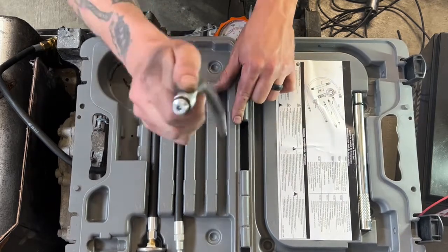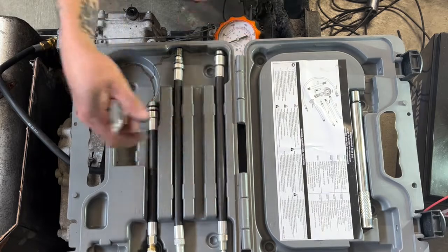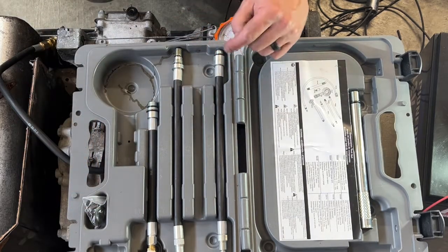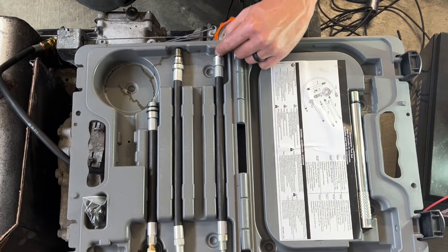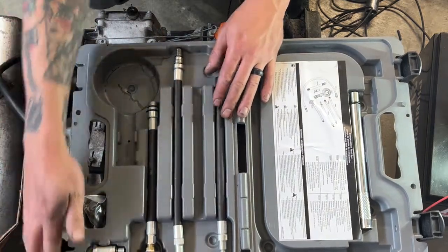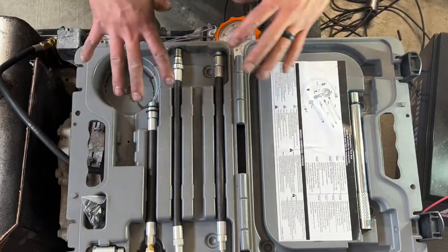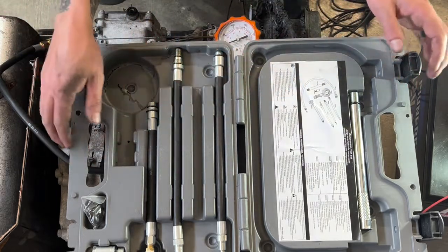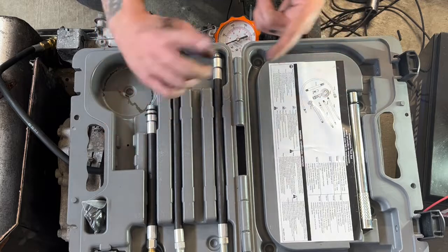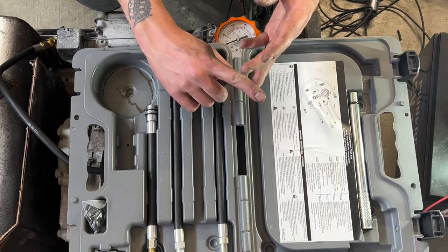You'll notice at the tip of these there's a little Schrader valve in there. During our engine testing, if it gets to the point that we need to do a leak down test, don't forget to take out your Schrader valve when doing that or you're going to be really confused with your results. But we're just going to start with the compression test. If compression looks good, we'll move on and transfer the block. If it's not, we'll do a leak down test and figure out: are the rings bad, do we have bad valve lash adjustment, do we have a chipped valve?